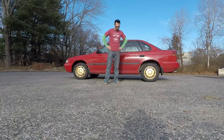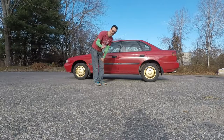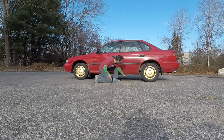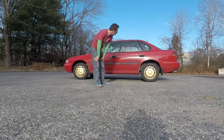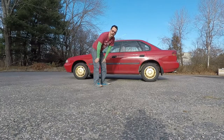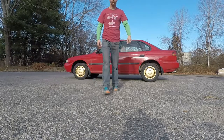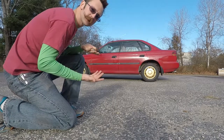I've already done a little bit of stuff to it. When I bought it, it was on the original 21-year-old, super saggy, actually broken springs. I kid you not, this car had less ground clearance than my Celica, which is lowered on King Motorsports springs, or the Miata. So I got '96 Outback struts and springs and had them installed. The spring mounts on the Outback struts are like two inches higher, and using fresh springs that aren't saggy got me an extra three inches of lift. I also took the hubcaps off and spray painted them all gold metallic — basically just like my WRX, really.